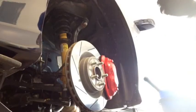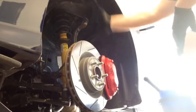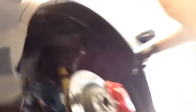Real quick, I wanted to show you something. This is not something I do every time because we don't have the wheels out. But obviously my wheel well is completely filthy. I'm going to take advantage of this because I'm going to end up putting Deluxe on the brake calipers here. Right up here, it's absolutely filthy — it's got all that brake dust caked on. Also, I'm going to take this time to really look around. I mean it's still a relatively new car — nothing crazy. Got a couple of rust spots right here on the control arms, but nothing detrimental. Just making sure all my pins are still here.